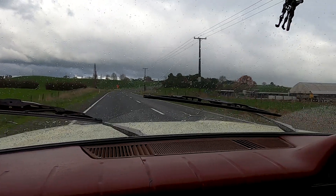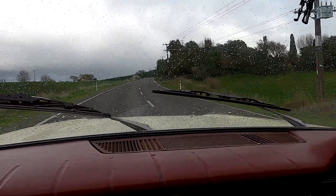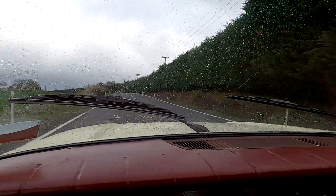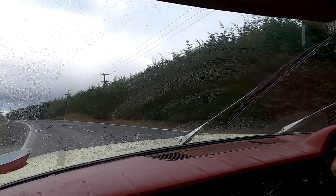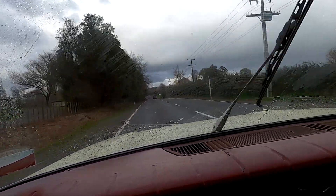So at that sort of throttle, it had to be over 100 km/h to reach overdrive. So here doing 90 in top gear. You have to get 60% throttle for it to kick there. My laptop has just shut down. What's the fuel temp at? It's running at 41 degrees. Coolant is sitting at like 80-82 degrees - a thing on the thermostat. That gauge is like 40 degrees, yeah - it's like nothing.